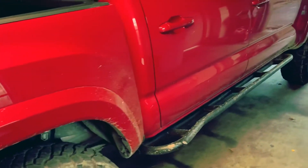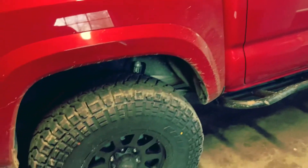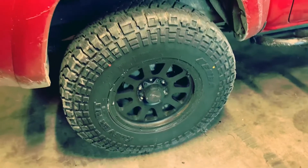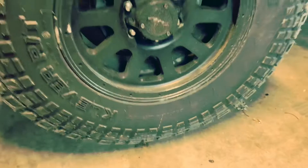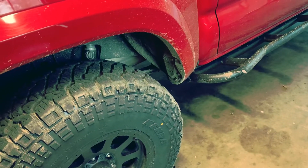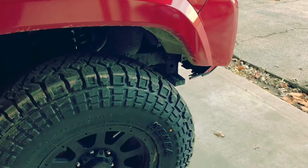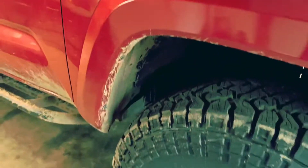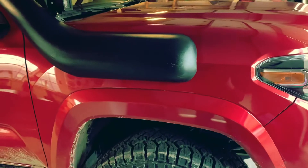I just wanted to get on here and talk about that. If you have any questions or comments put them down below and I can help you out. These are the Kenda Klever R/T — 35x10.50x17s — and for the most part they'll fit on your truck a lot easier than most 35s, because most 35s are 12.50 and that's where it starts rubbing pretty much everything. I've seen a lot of people have to trim their fenders, mainly in the front when turning. These fenders are not trimmed, with the exception of the front bumper — which I did before the 35s — and then the CMC and pinch weld. That's the only trimming I've done. Overall pretty happy with it, thanks for watching!